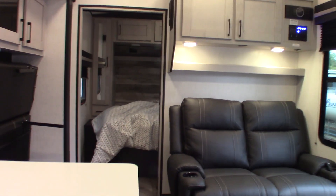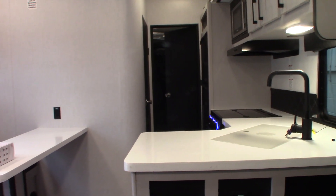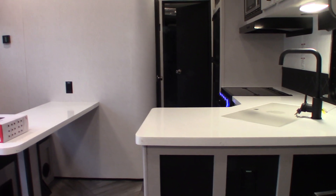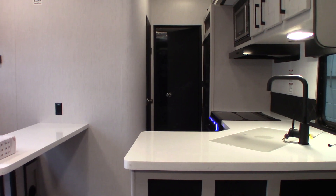We pretty much covered it, and like I said we'll go over everything with you when you pick up. Thank you for purchasing your trailer here at National RV Detroit. Remember to inspect the roof every 60 to 90 days — that's an important part of your regular maintenance. Right now there's no antifreeze in the system — it's all been replaced with fresh water, your water heater valves are in the camping position, and the water heater is filled with water. Never run the water heater without water in it.